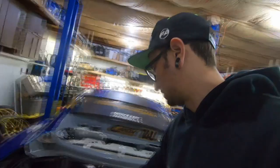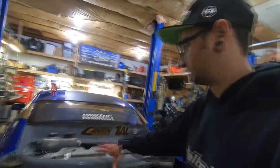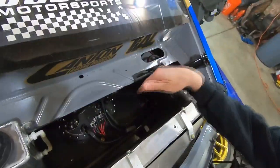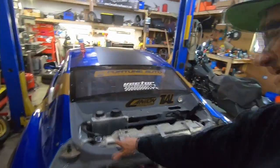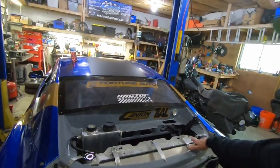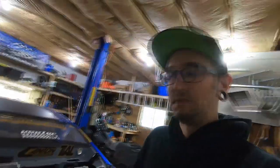Back here we're also taping off around the fans — I should really tape this off as well — because what this is doing is creating a pressure differential. This side is ideally low pressure and then you have high pressure on this side; high pressure moves to low, that's the way it works. This gap is technically a leak, so with this sealed off it would be even more efficient. We also went and kind of capped off the back on that stuff, and I mean it's really a simple setup — there's nothing super crazy to it.